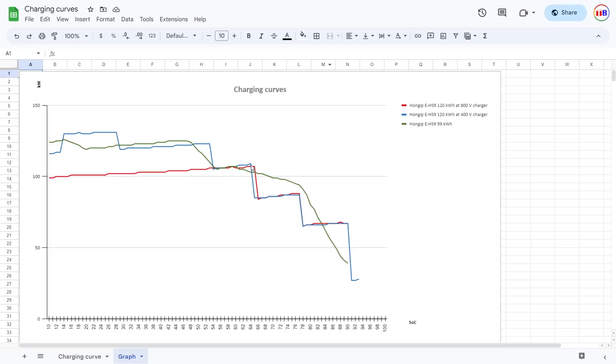The slight difference might just be that when I look at the charger screen it was 1% off — it could just be a slight measurement error. What I wanted to show is the red line here: when charging at 800V, it seems to be capped at 252A. And then as the voltage rises you get slightly faster speed until it drops, and then it just follows the other session pretty much spot on.